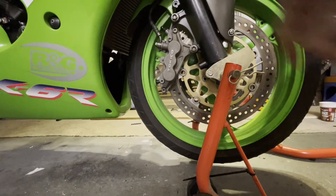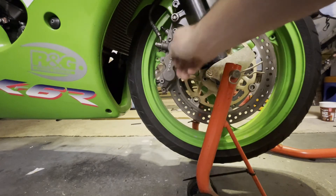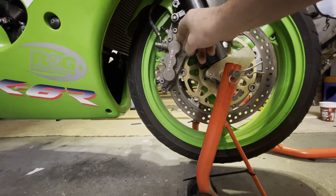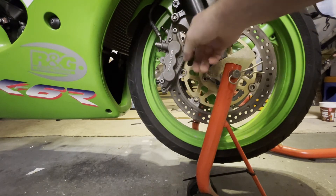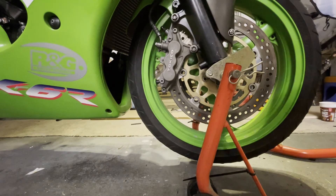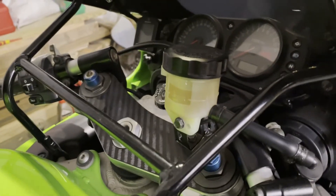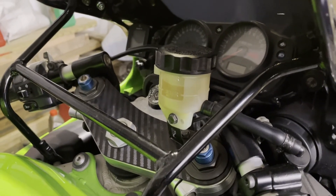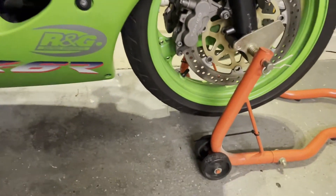I dried it all off with a rag, just kept looking, kept pressing the brake, and nothing was coming out. So all I can assume is it was only a tiny bit - the residual brake fluid left over from bleeding the brakes perhaps. But yeah, that's fine. Both done and dusted, so happy with that. All that's left to do on this now is just top that up again - it just dropped a little bit - and that's it, done. Brake issue resolved. Glad I spotted that before I went out on it properly.